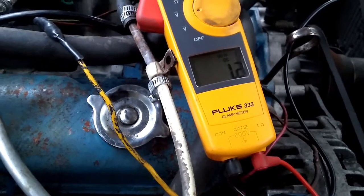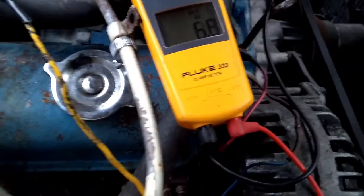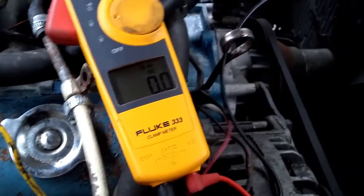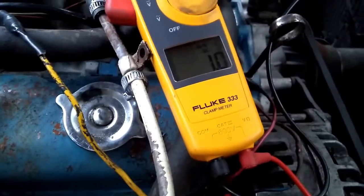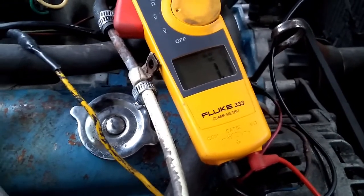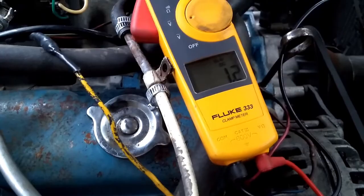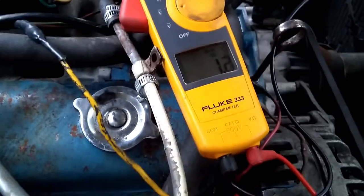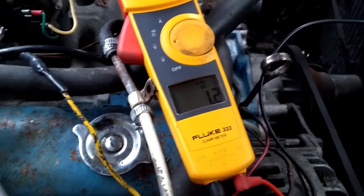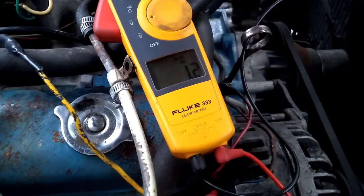You can see we've got a lot less voltage on one side. The side that's high is the inlet — that's power going into the field windings. The other one, the one that's low, is the output from the field windings, which goes back to the voltage regulator. The voltage regulator on this is simply a switch — all it does is connect this field terminal to ground. When it connects to ground, electricity flows through the field windings, energizing it and causing the alternator to charge.